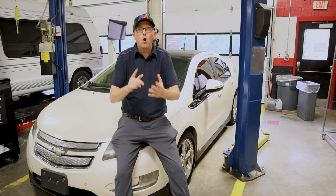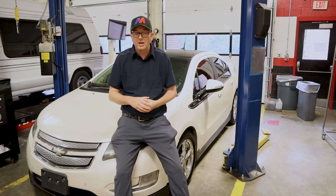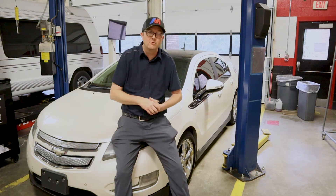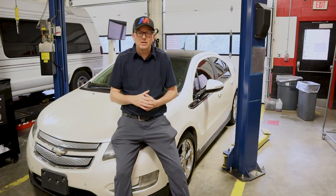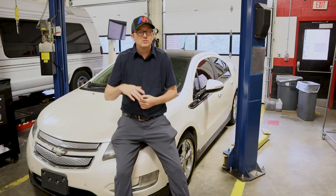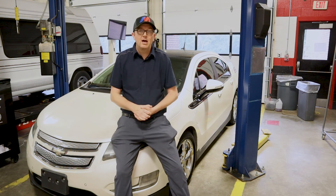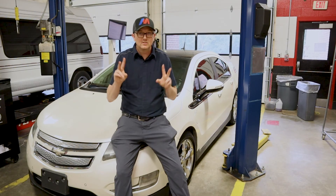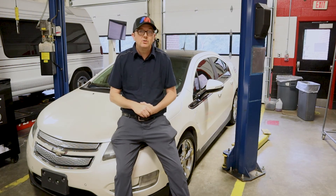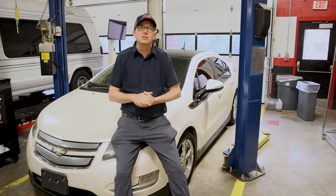I hope if you have a Volt, it's something as easy as the 12-volt battery. Remember: if you have to replace your 12-volt battery, go with a factory AGM battery as a baseline. Go ahead and get an AC Delco AGM battery and put it in the car. And don't forget to erase those high-voltage secured DTCs in the high-voltage control module. Hopefully you learned something — if you did, please give me a like on this video and subscribe to the channel.